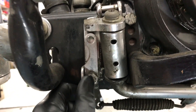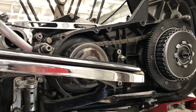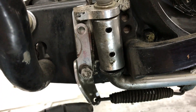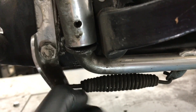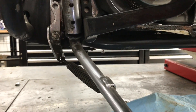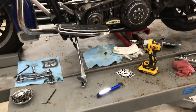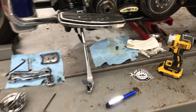You've got to think — if this bolt comes loose, this is a V-Twin Harley-Davidson. We know they vibrate and a lot of people just don't check their nuts and bolts often enough. As that comes loose, it's going to allow this to go backwards, which means that spring could possibly come off. The operator could be riding down the road, have their kickstand flop out, go make a left turn, and now we've got a really bad day. So you've got to pay attention to that stuff.